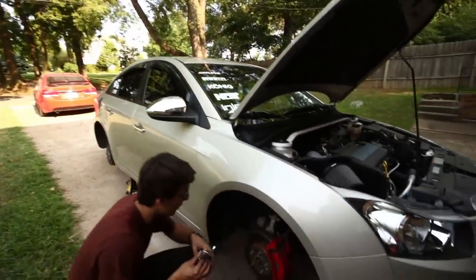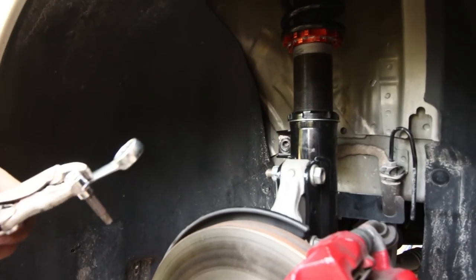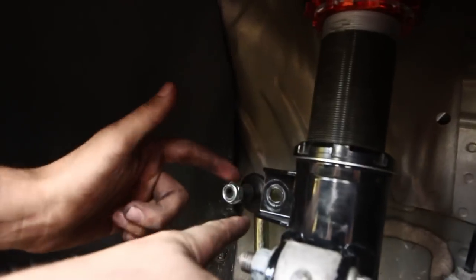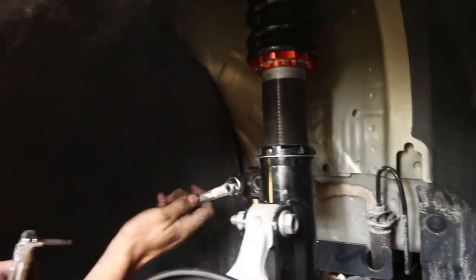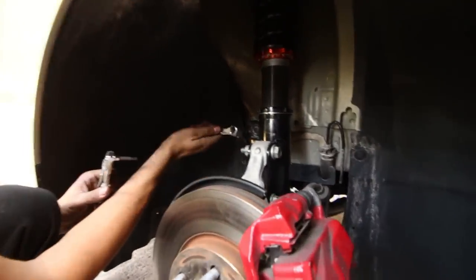Anyways, okay, so I spent the last 20 minutes freaking out, but if you jack up the strut, the hub assembly high enough, watch your knee there. It seems to line up. Look at that. So basically what he's talking about is the sway bar end link lines up with the hole perfectly if you just put some load on the spring. And we're going to be adjusting the height anyway, so it's going to be pretty close and it should be okay. So he's just going to put that on and we should be good for the front end for now,